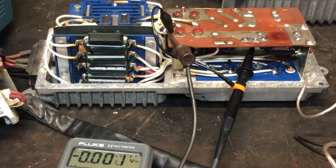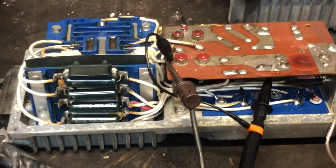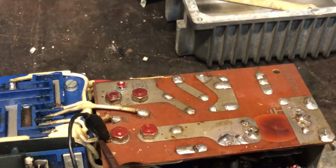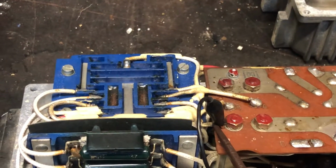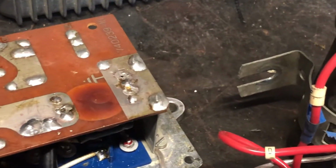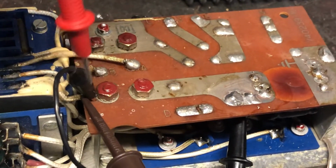One last part about this is the high voltage side, and I can't show that on the scope, unfortunately, because the scope can't read that high, especially since I only have 5 volts per division. So it's quite interesting because you have 12 volts coming in and this transformer creating this crazy buzz, and that oscillation will amplify this voltage just like it does for the sparks actually. But if you want to see that in action, this is the 12 volt side.